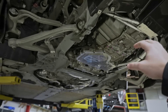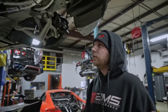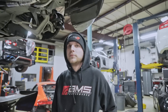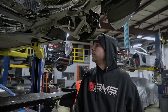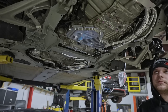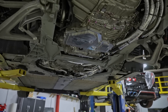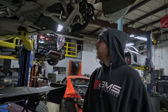Before we show the car on the dyno — with it being a stock gear set, we've got to limit the torque. Our Stage 2 Plus is rated at 800 foot-pounds of torque, and you're going to see we're going to be making just below 800. The biggest fail point on these is second gear. This car is going to be awesome — the perfect setup for what they want. We do recommend a second gear upgrade. If you don't do it you're fine, but if you really want to launch your car from a dig a lot, second gear is almost a must. For just casual cruising, driving, giving it a punch in second gear, lighting up tires — this thing will be more than enough.